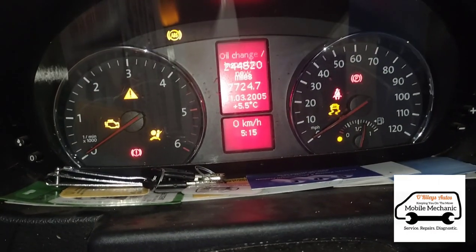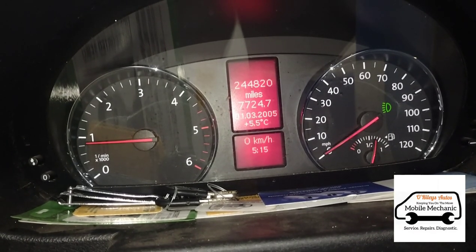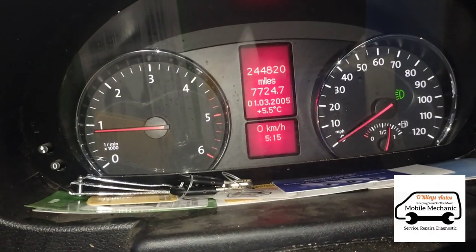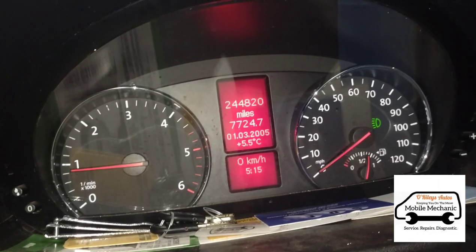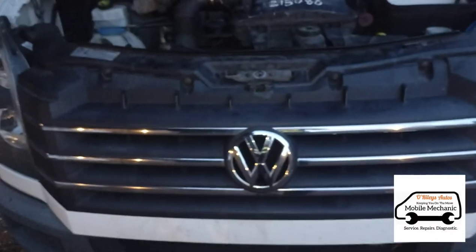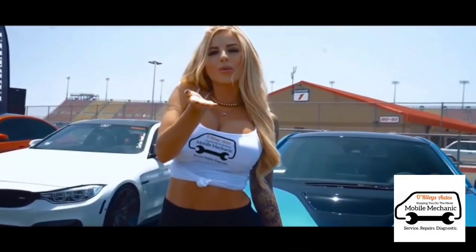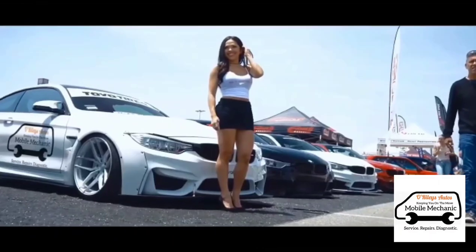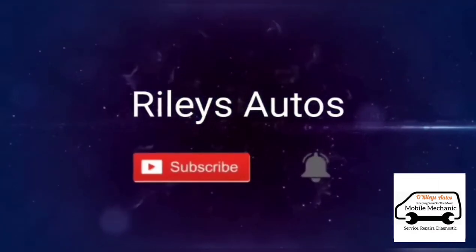Press stop on that and go back to the engine of the van to start it up. If you've left any air in the system it might run for 5 or 10 seconds and then stall out — we'll see. All is good — it's just keeping running. Let it run for at least a minute. That's all good, so we can switch it off — that's the service all done. The coolant is already at a decent level and we're going to fill up the windscreen washer as there's a message for it on the dash, but that's it — the whole service is complete on the VW Crafter 2L TDI. We'll see you next time.